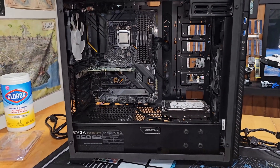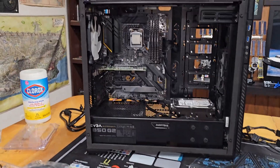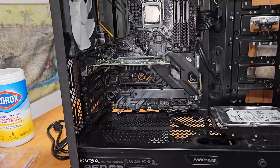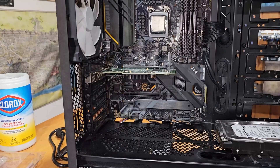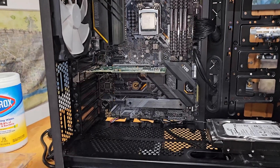You'll notice that the red SAS cables are missing. That's because the SAS card is gone — that is not the same SAS card. Luckily I discovered before I did all the hard drive swapping that that card was not Unraid compatible. It only works for standard RAID; it does not work for Unraid or Linux OSes. So I had to go get a new one.